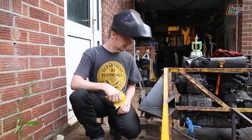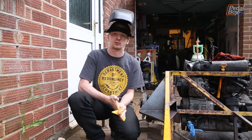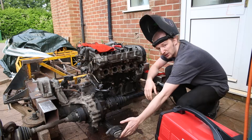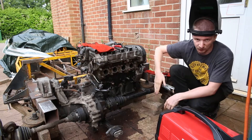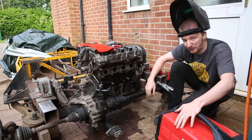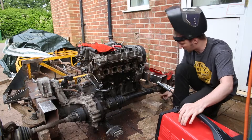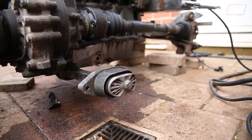We're all done welding up the driver side bracket now. We're going to move the car back a little — we need to extend out our chassis legs so that we can then build down our frame to take the lower suspension arms. I've just finished extending our chassis legs here. We've had to bring them back a little bit further and clear the diff casing so they're better lined up with our gearbox mount. What we're planning to do is drop down inwards at a nice 45 degree angle, then have a horizontal structure that runs across, secures our gearbox mount, and back up the other side. We're also going to attach our lower suspension arm linkages to this piece — there's a knuckle joint at the bottom of the hubs that arms will come off of, attaching roughly symmetrically about the centre of the car onto our frame. You'll get to see that on the next episode of Pedalbox.